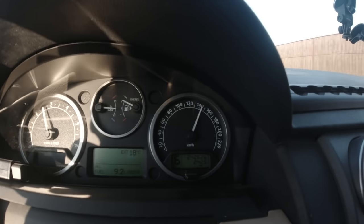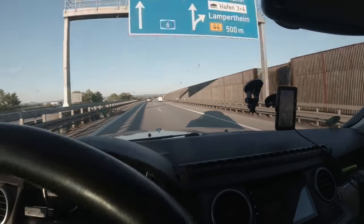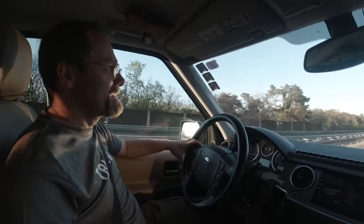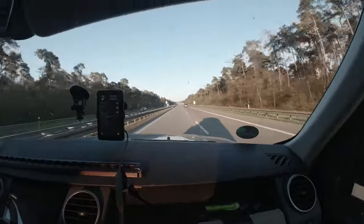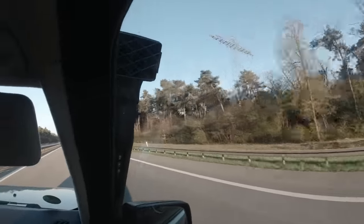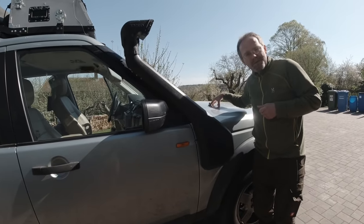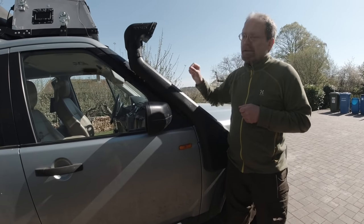Looking at our cruising speed gas consumption on a fully loaded vehicle — we drove with the snorkel facing forward for about one year. If we operate the snorkel facing forward there is a ram effect, and that ram effect does not match the engine mapping. That will artificially increase diesel consumption without increasing power.